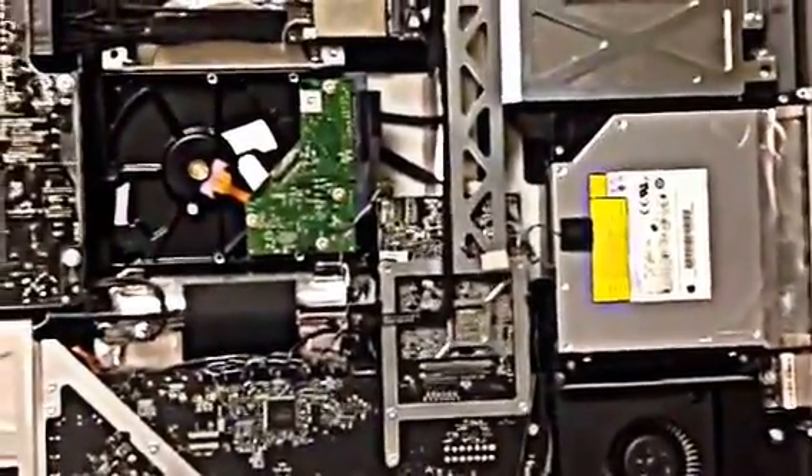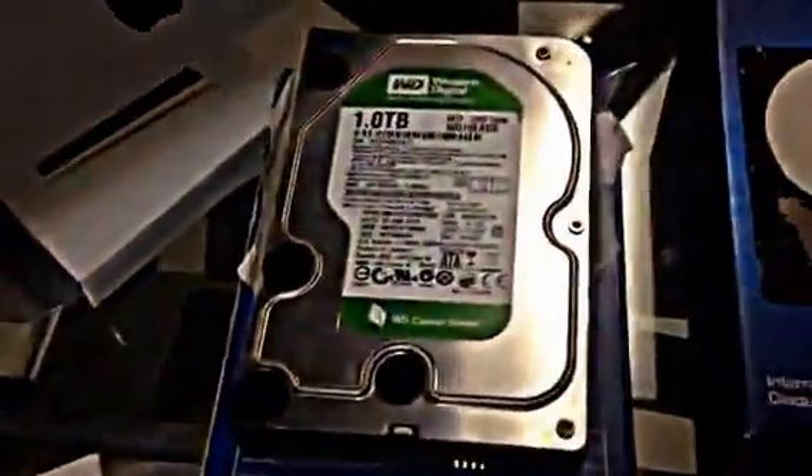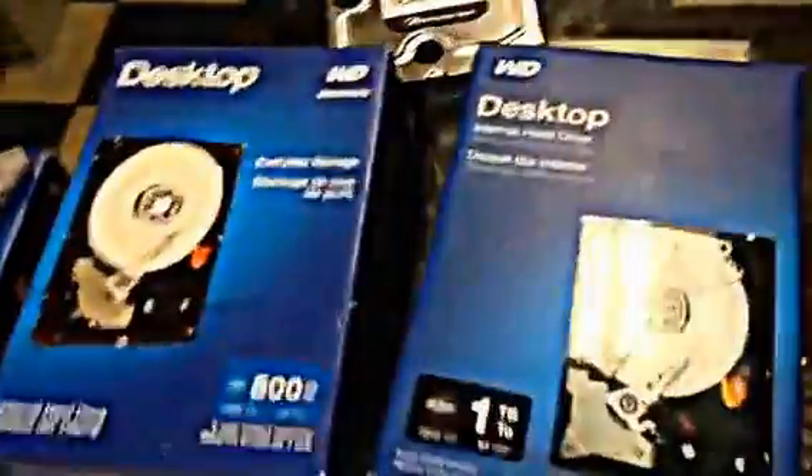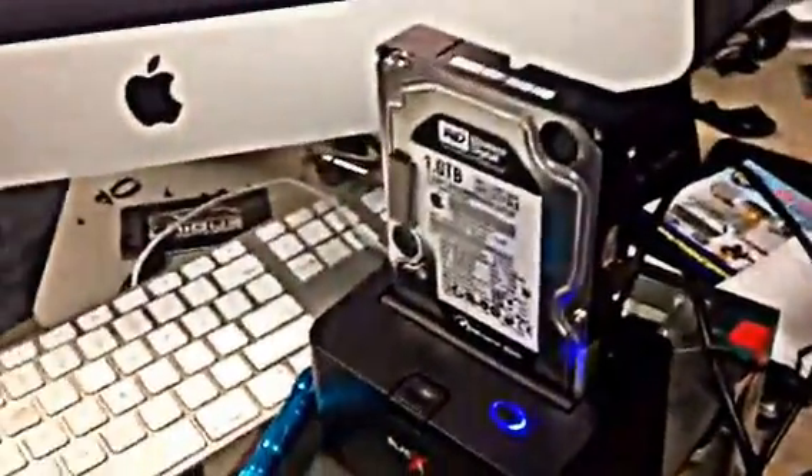In conclusion, use the Black drive when repairing an iMac. You don't always have to get a hard drive with the Apple logo — these Western Digital drives work perfectly without it, but you do have to format them in a Mac environment and make sure it's formatted for the OS. I have an external here: you connect the hard drive to a machine, transfer the data out, format the drive, and then put it in.